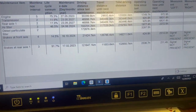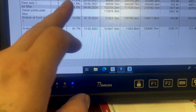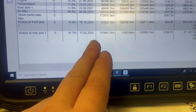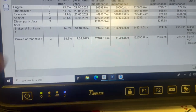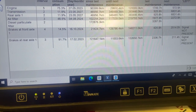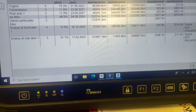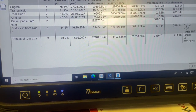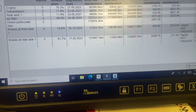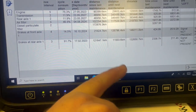Here's the next day — I'm just on another one as an example of what it looks like when it wants something doing. Engine is fine at 75%. Rear pads — it says it's due February, 91%. The light is probably going to come on before that, so we're going to do the pads on it and check the rear brake chambers, pull them away, because they have a problem with the rods on them — sometimes they snap on each side, so you have to check them every time you do a set of pads.